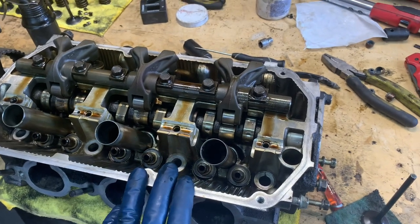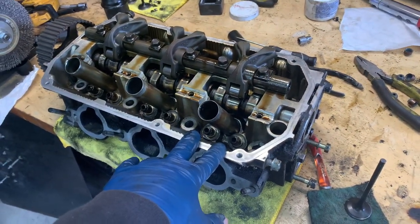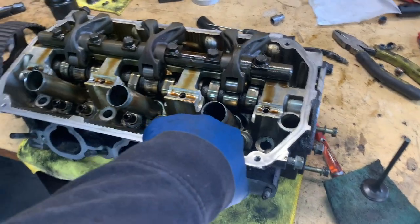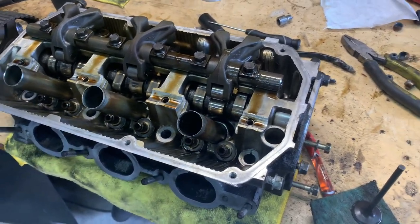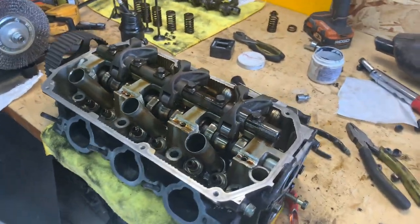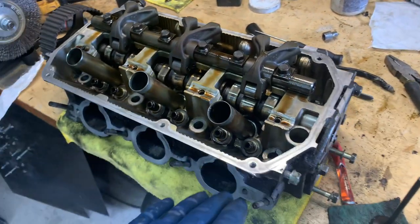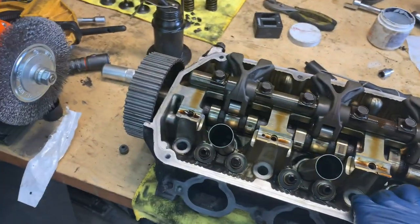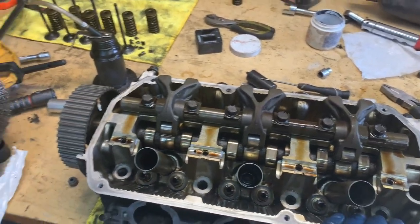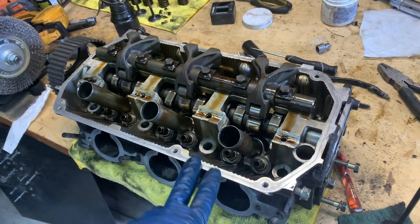If you're doing a head gasket job, go in and do these. If you've already got the block torn down and the heads off, it's way easier to do this outside the car than inside. If you have a shop doing it, make sure they're replacing these and going all the way in. Make sure to get good gaskets you can trust — I use the Felpro ones, some people swear by the OEM ones. In the case of this Montero Sport motor, this is the 3.0 and it's got 24 valves. So there are 24 different spots between the two heads for it to leak oil. If you don't change these they can definitely blow blue smoke and run you low on oil.